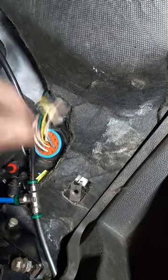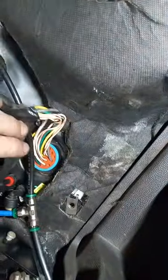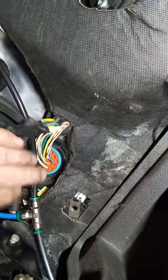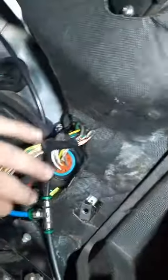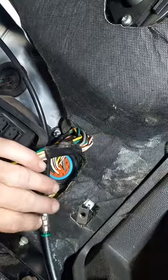Here's your supply again. I lengthened it a little bit — there's the green line coming out. So I put a connection in there, a three-way, and solved my problem. So I have an air horn and the bags don't lose air anymore for the cab.